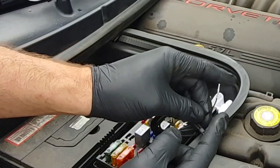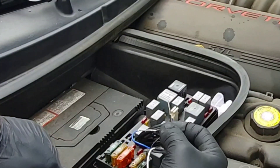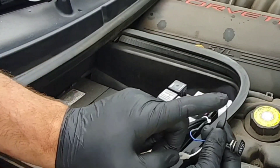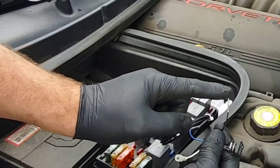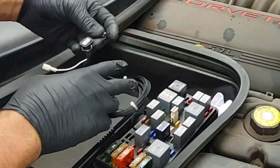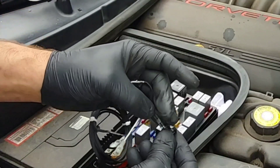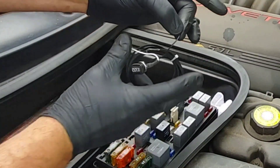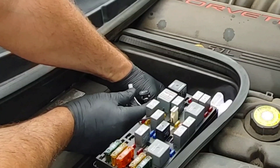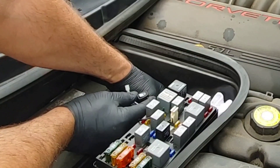After that you have the black wire. The black wire is black for one reason — it's a ground. You don't want to put the positive red wire on this black ground. These wires control the negative side of the relay, so you don't want to put 12 volts there, just the ground. So I'm going to start the car and touch the negative terminal of my battery. Now I'm going to be able to turn the switch on and off to control the fan. I touch the ground with the black wire — I can hear the fan kick on. I turn off the switch and I hear the fan stop. It works — the system is confirmed working.